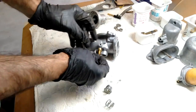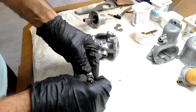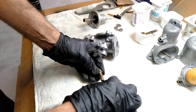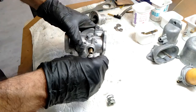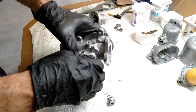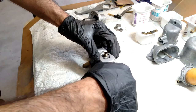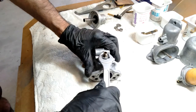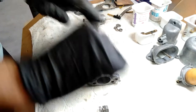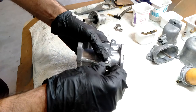The way this goes: the brass fitting goes in, then that goes on, that screws into the body, then the spring goes on and then that piece goes on there. You can insert it that way or just put that piece in first and screw this into the main body. That will need to be tightened down. Then we can insert the spring and then this bottom nut.